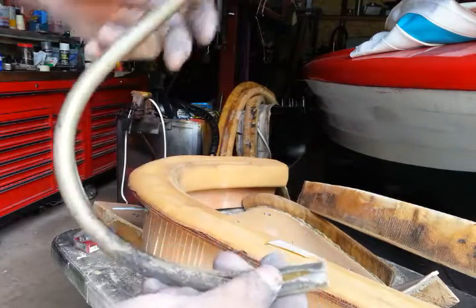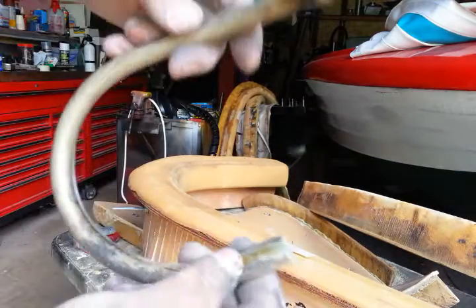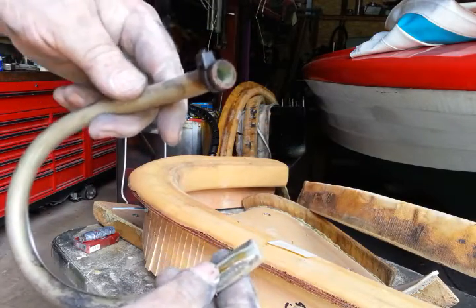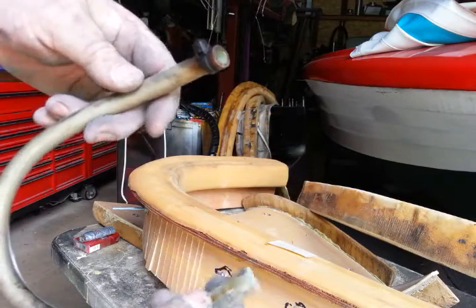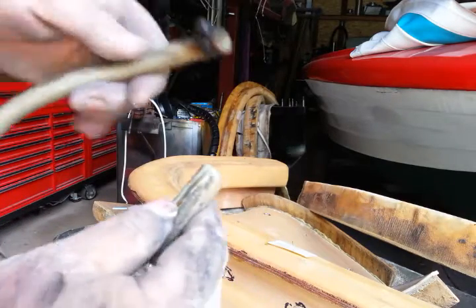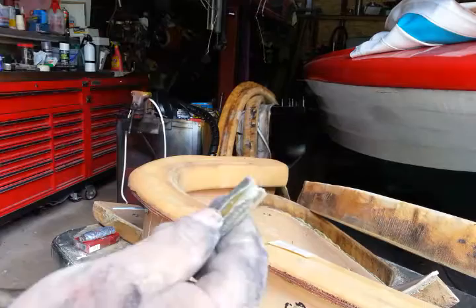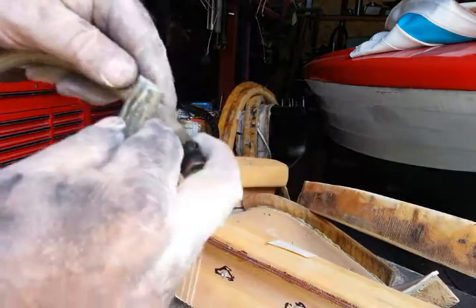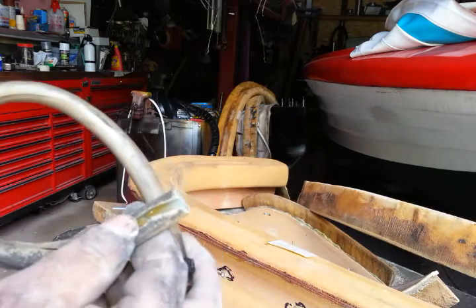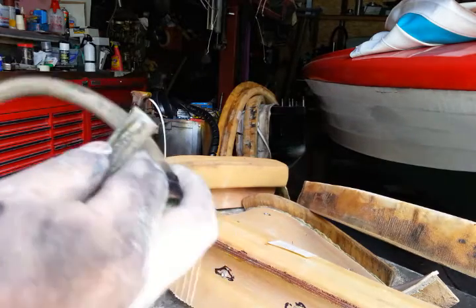This was gray hose. A lot of people may go buy it at Meyers, Walmart, or even Quicksilver. They sell the junk. And why I say junk is our gas has ethanol in it, unless you are using marine gas — what I'm going to call it — non-ethanol fuel.